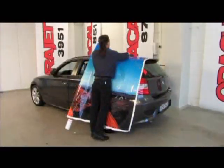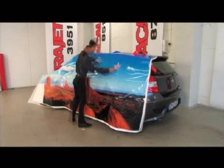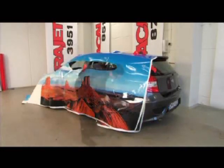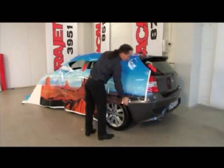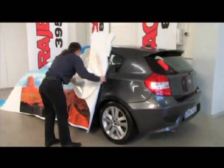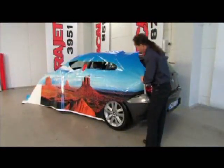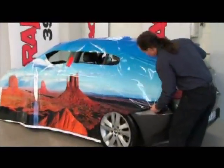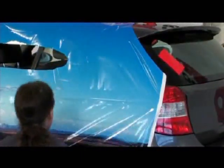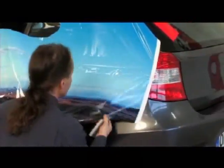After aligning the vinyl with release liner still in place and placing it on the car, and after feeling for the vehicle contours, the vinyl is now roughly cut to shape. When doing this, the vinyl should be held away from the vehicle to avoid damage to the paint surface. With some slight tension, the vinyl is now brought down onto the paint surface, without stretching the material, to avoid distortion of the motif.